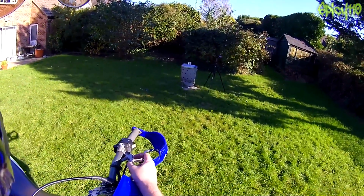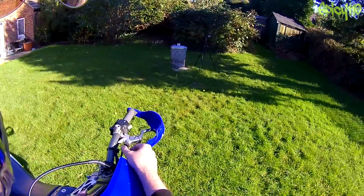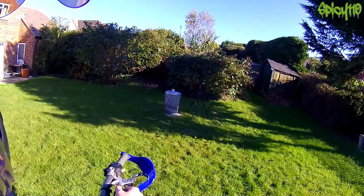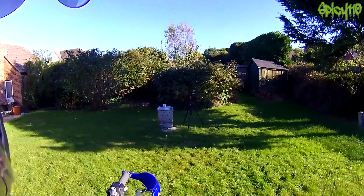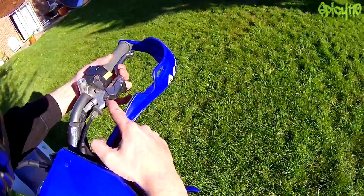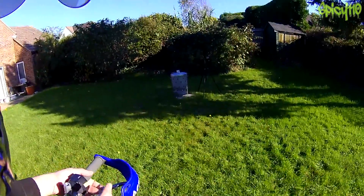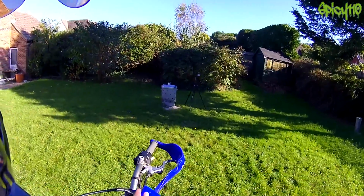There's basically a little adapter thing that you can buy that you put on the end of here, and you can squirt GT85 down your lines, for instance, and it keeps them lubed and stops them from snagging and starting to fray and things like that. But that's another thing that you need to keep an eye on. If you pull this back here, you can see part of the cable. If that's frayed at all, buy a new cable. If you see any fraying, top or bottom of the end of cables, replace them. They are going to go.